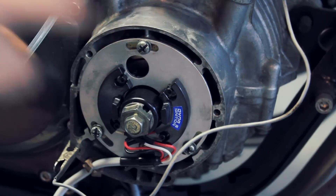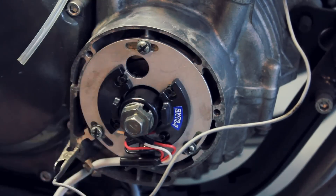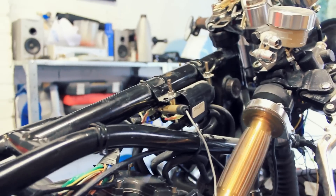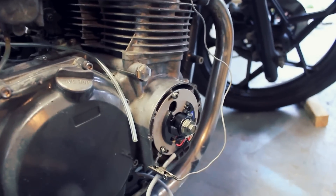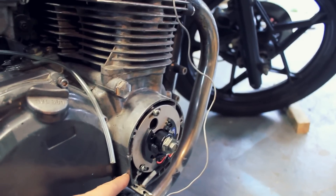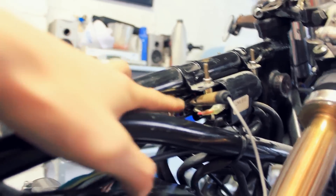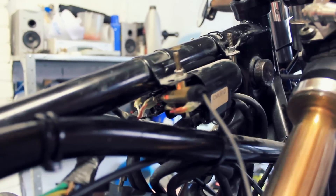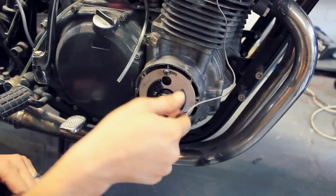Now I've got all the wiring done, so it's all wired as it should be. The new wires go to wherever the previous old existing wires were, so it's pretty much a like-for-like swap. Up here I've put that little circuit tester that I used in the last video when I was showing the points. I've hooked that up to the negative and then up to the positive of coils number one and four. When the engine gets switched on, when it's at the correct firing position, the light will go on and off.